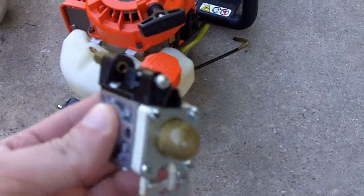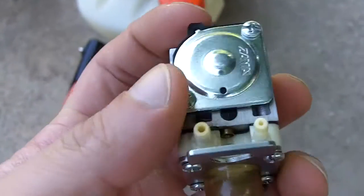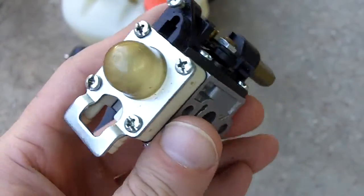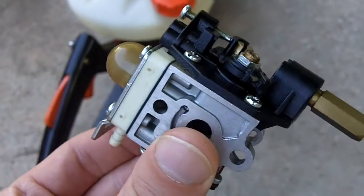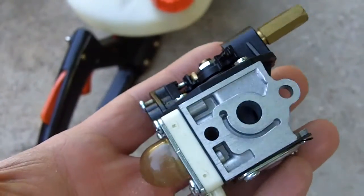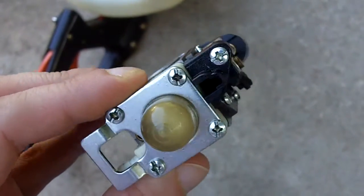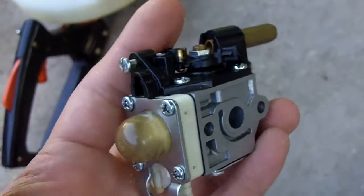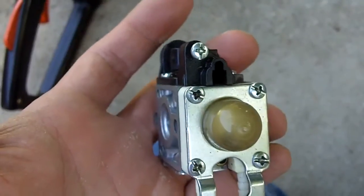Usually, if you have problems with your machine running, and you've checked your carburetor and it all looks good, and you've also tried replacing all the hardware like your diaphragms, metering levers and needles, and it still gives you trouble or still isn't running right, then you're probably better off just getting a new carburetor, because the ethanol in the gas can damage these permanently. That's usually the best thing to do. And besides, with a new carburetor, your machine will run so much better.